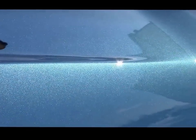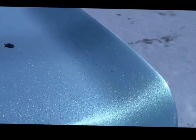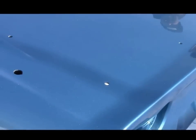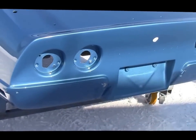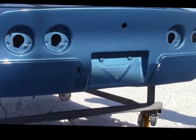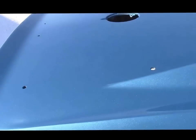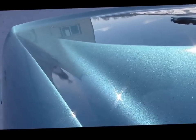We're just not sure how well the metallic will show up in the video, but hopefully you get an idea. We took a basic Le Mans Blue and changed the recipe — the shade of blue is consistent with the General Motors Le Mans Blue, but we modified the metallic. It's not only heavier metallic, but also a coarser style rather than fine, and it has a sparkle to it which really makes it stand out. Under normal conditions — if this Corvette was parked in the shade or in a garage — you wouldn't really notice the metallic dancing that much. But under natural lighting with the sun hitting it, if the camera catches it a certain way, you can see how pretty that metallic is. It really gives this Corvette a nice shape and a really nice contour.